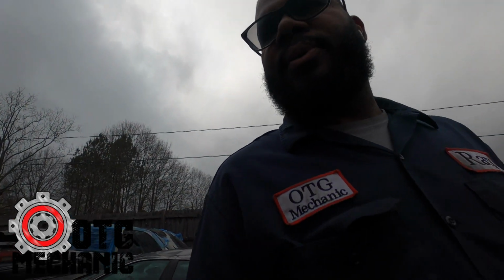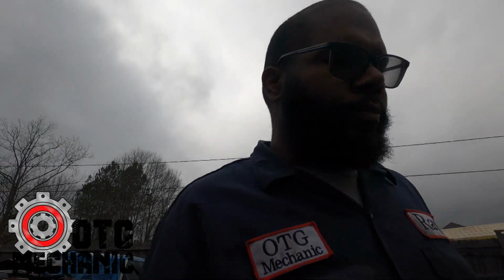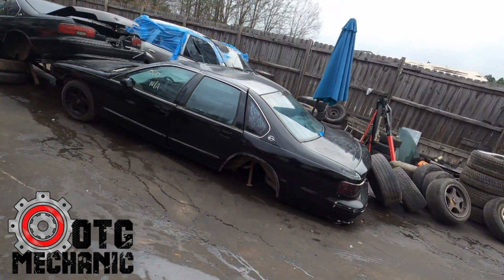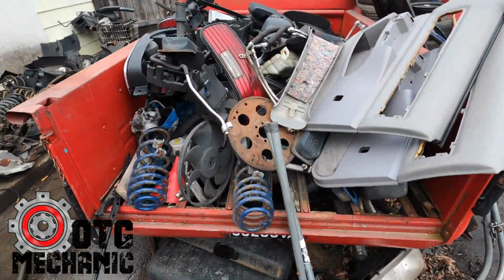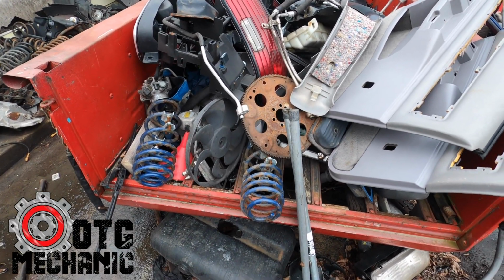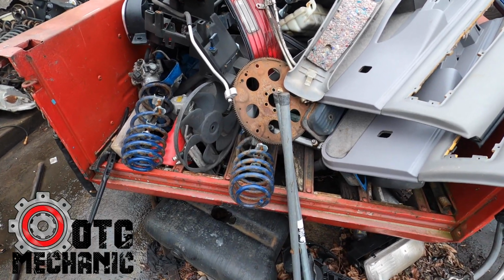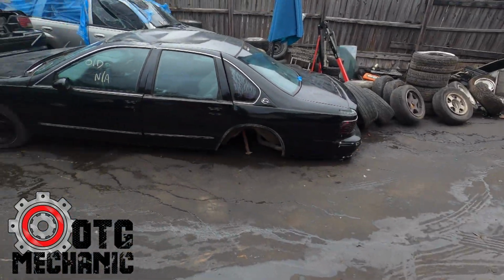I wonder if that flywheel will work for that truck that I got. I'm going to ask him, because I need one for that Silverado, and I think it's the same flywheel. It's a 350 going behind a 4L60, so I think that flywheel will work. It isn't cracked or anything, so I'll check it, but it should work. Hit him up. I'll put the link in the description for his stuff.